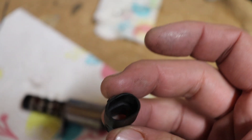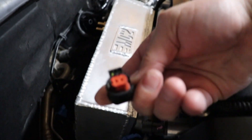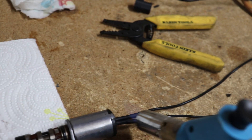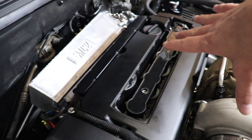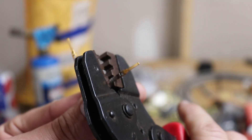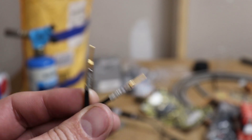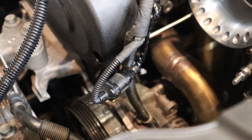Essentially what I did is I cut this connector off with a hacksaw, which left us with just the outer housing and the two little prongs that stick out — that this connector connects to, as you can see here. Luckily I still had two pins from when I did the coils. Just to get things going I'm going to leave the stock one in for now. I cut it down, soldered on a couple of wire leads, and extended it. I took this little housing and basically did some plastic welding with zip ties, made the bottom of the housing again, made it nice and strong, extended it — now it's out of the way. The intake is on for good.